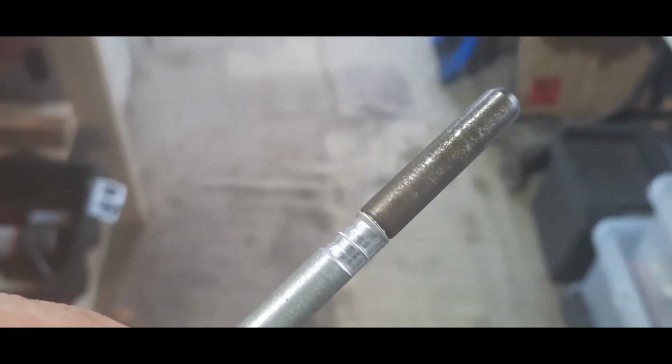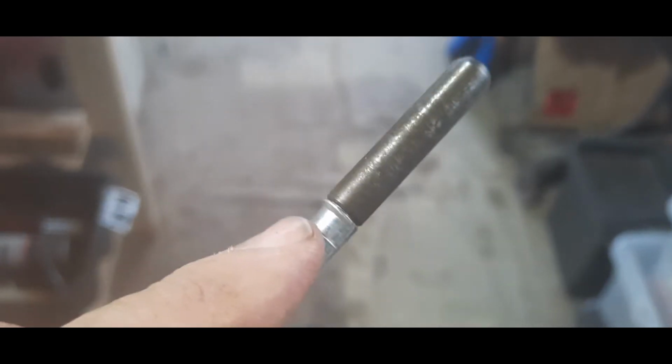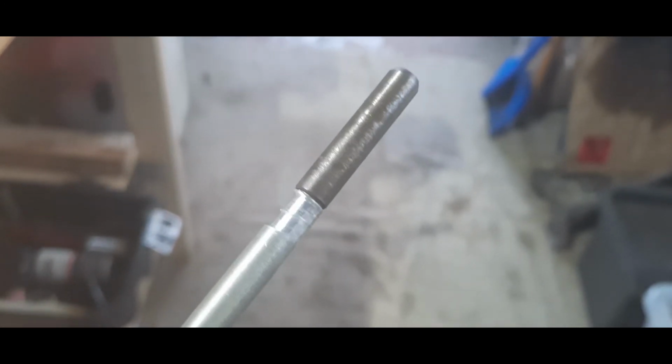And that may be the reason why I was getting a problem with disengaging the clutch, because it was getting caught on that lip here and maybe at that end there, and obviously it wasn't disengaging the clutch, which could have been the problem. Anyway, just thought I'd make a comment on it. If you've seen anything like this, do let me know. Maybe someone can answer the question as to why it started to wear in the first place. Bit strange, but there we go.